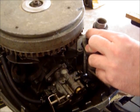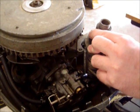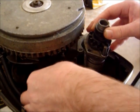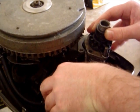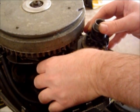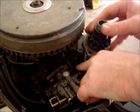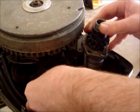Holding with your left hand, being very careful — you take a seven-sixteenths inch wrench and start loosening it up. I've already done that ahead of time. It's a little easier if you slide these forward just like this a little bit as you're pulling it. Be very careful. If the little nut falls at the bottom, it doesn't matter — you can easily retrieve it once you get the carb out. You just slide this forward like this. It kind of fell down to the bottom right here, no big deal. I'm also going to remove this one as well.